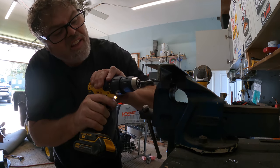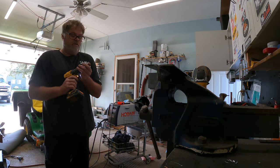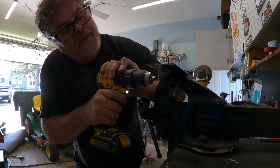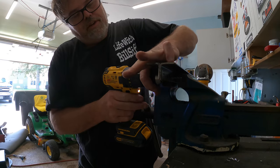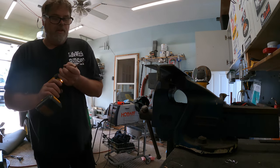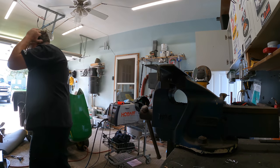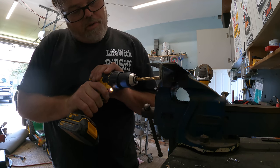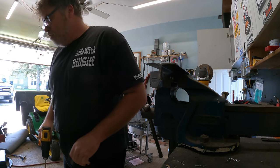So we're going to go right there. Easy, gentle. This ain't my favorite drill bit. Make sure you don't go with your highest drill bit possible. It's a really small one and we'll just walk our way through it, nice and easy. There's a pilot hole — we'll go up to this one. I think we're going to run a carbide tip through her. She walked right through. Light and slow — unless you have a high-speed drill bit, go slow.